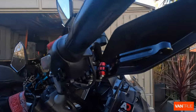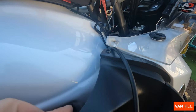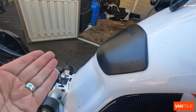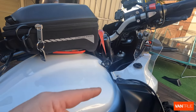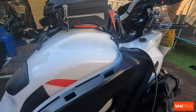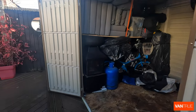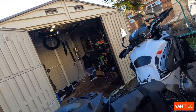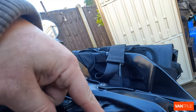So I've found my path for the cabling. I've taken the cable round the back, going inside here, and I've pulled this panel off. I'm going to come down here and go just under the tank. I need to take this bolt out so I can lift the tank and bring the cable out somewhere down the bottom. I should be able to run the front camera cable the same way. So we are done — we've got both our cables coming through. All I've got to do is plug them in. We've got the rear-facing camera coming through the back, plugged into the controller.